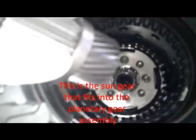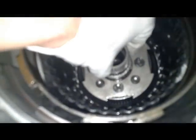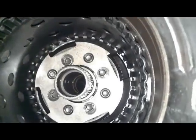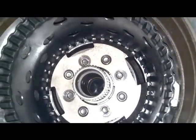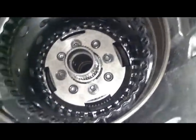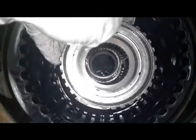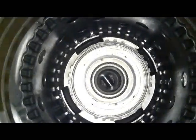Next is this little sun gear with the washer, which only goes on one way. There are special grooves in there, it only lines up one way with that washer. This just kind of drops in, seats in place. There are little grooves on that sun gear shaft — I don't know all the terms — but these grooves line up with that, same as that washer. Once you've got it lined up, it'll literally just drop right in. You've got that gap on the sides there — I believe it's probably just for trans fluid, for oil to get in between there.